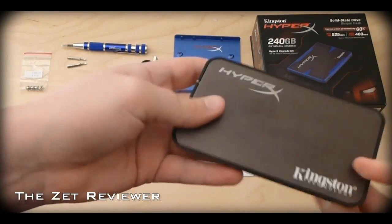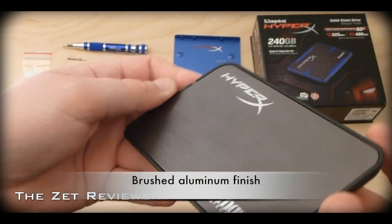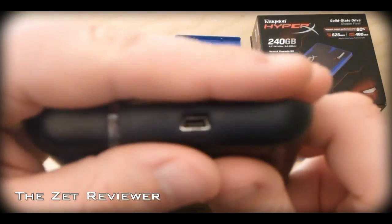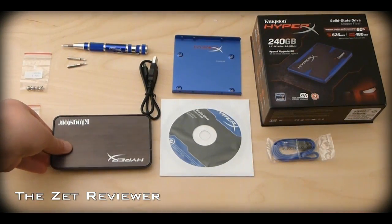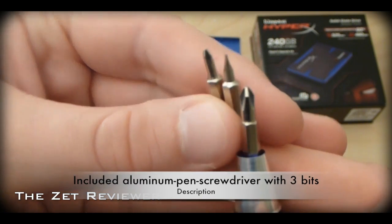The negative things about having an SSD is that they are very expensive and they usually come in pretty low capacities. Therefore it is strongly recommended that you use the SSD for your operating system and for your larger programs, and that you use the hard drive for your data such as pictures and videos that you don't need running that fast.